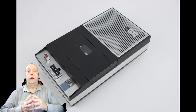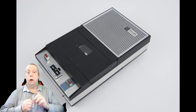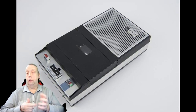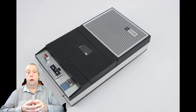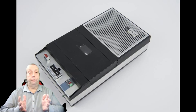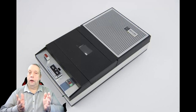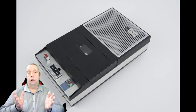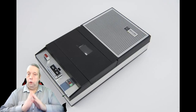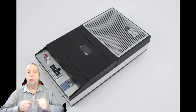When I was a Panasonic service agent, there were different greases called for different uses. Cogs had one grease, dampers had a different grease — there were about six in the kit and the kit wasn't cheap. Three-in-one oil and that sort of thing was not allowed, because you couldn't guarantee it wouldn't contaminate something. The belts could get contaminated, the pulleys and rubber idlers would go slipping. The greases and lubes you had to use were the ones called up by the manufacturers.